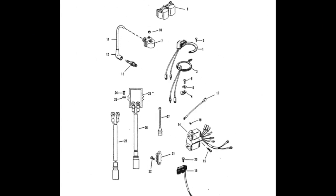All right, DIYers, we are on the computer, and before we head to the actual boat and discuss all of the parts or the common causes, I wanted to show you our exact serial number outboard ignition diagram. And again, as I mentioned in the intro, really the three common causes are your spark plug, your spark plug boots or wires, or one of or both ignition coils, or even worse — however unlikely and uncommon — is your switch box.